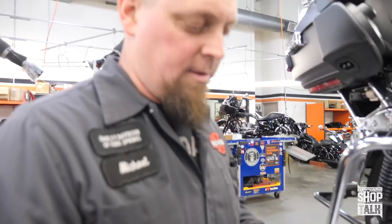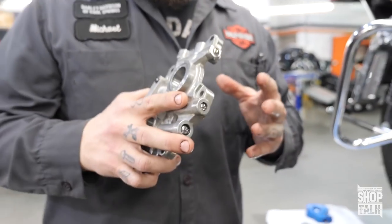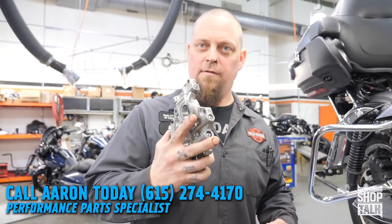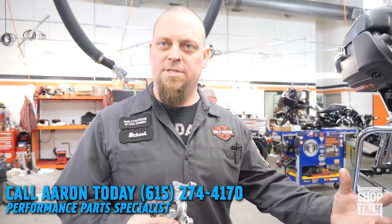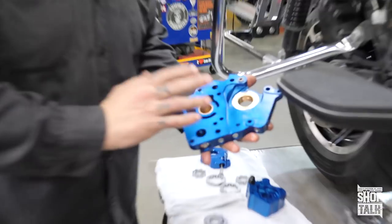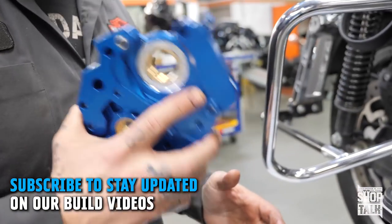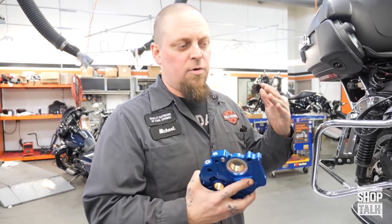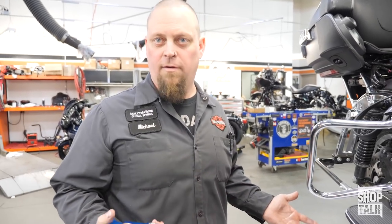The pump and the cam plate are made of very strong billet aluminum, offering 50% more strength than the OEM structure. The OEM plate and pump are cast, and the reason for that mostly comes down to cost — they build hundreds of thousands of these. An S&S or Fueling cam plate is built specifically for performance applications. The OEM parts have adequate oil flow and pressure for 90% of motorcycles out there, but the S&S parts are very robust: all portholes are matched, machined from billet, and a lot of care and time goes into them. It just wouldn't be cost effective or necessary to put this into a stock motor.